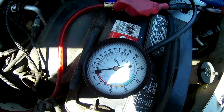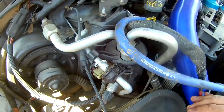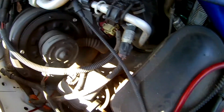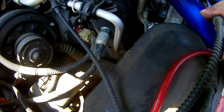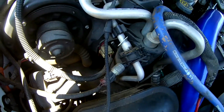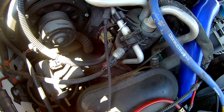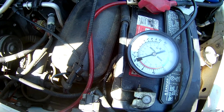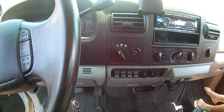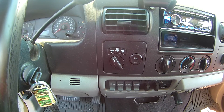Okay so now I have a vacuum gauge going right into the outlet pressure here that goes into the pump. It looks like there's a black wire going right into this pump. If I don't get vacuum that's either this wire, the pump, or the solenoid. I'm going to fire this truck up and see if I get some pressure. Alright, my truck is now running and I'm going to actuate this 4x4 lever — I should be getting vacuum out of that thing.